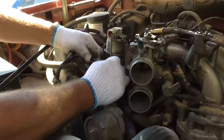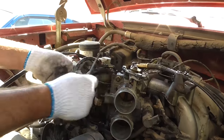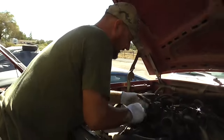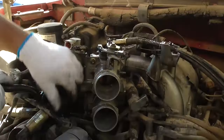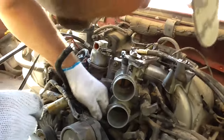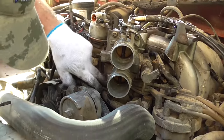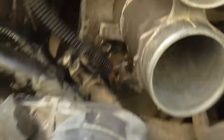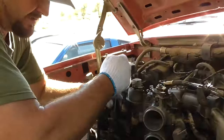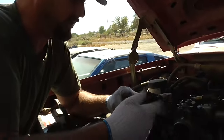They put a cooling port inside of the throttle body to so-called keep it cool, but when the engine's hot, I really don't believe it keeps it that cool. There's another little bracket that needs to come off — these steel brackets, you don't need them, piece of junk. Gradually getting stuff out of the way. There's a lower cooling line too. It just keeps getting better, doesn't it? Get this vacuum line out of the way. There's my throttle position sensor way down there. Doesn't look like I'll be able to change it without pulling the throttle body. But I will unplug it. Play with the clip and unplug it.